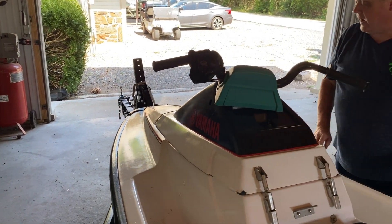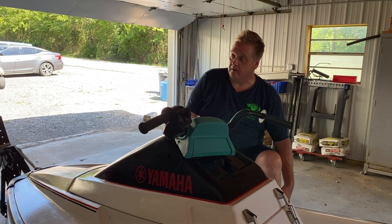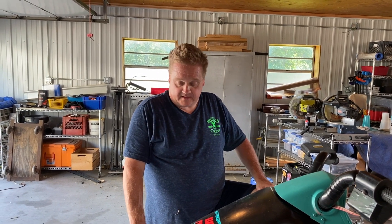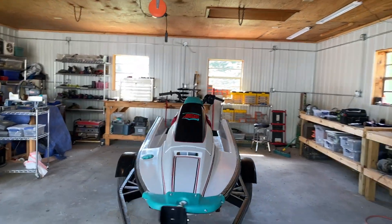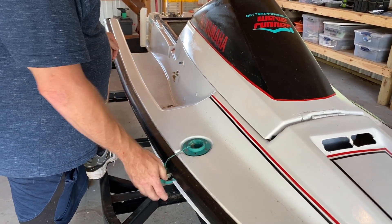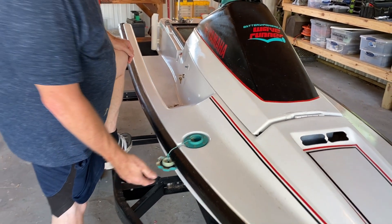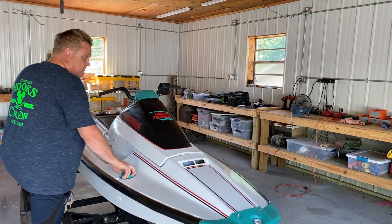We are going to put two chargers on there. If you run one charger to one battery, you will get your 12-volt charge, and one charger to the other battery for the other 12-volt charge. It still has the capability of a 12-volt system running from each battery individually — you only get the 24-volt system when you run both batteries together. We are going to use where the gas port was and put in an electric cord that you just pull out, plug in, and the chargers will charge the batteries automatically. That is our electric wave runner converted from gas to electric.